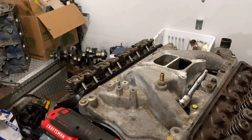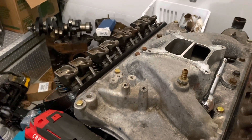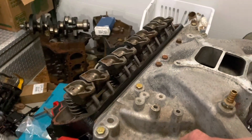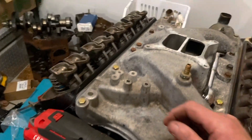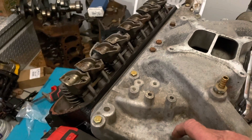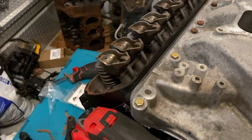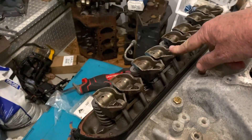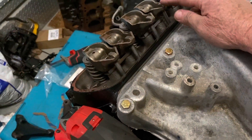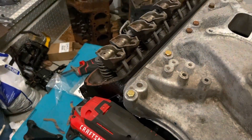With half the lifters and valve train installed, I want to point out two critical requirements when checking preload. First, the lifters must be empty — not pumped up with oil. If the lifter is hydraulically locked with oil it won't move, which is actually its normal operating function: to hydraulically eliminate play. Second, you must be on the base circle of the cam. If the cam is trying to open a valve, that rocker will be raised and won't have any play — so you can't check preload on it.